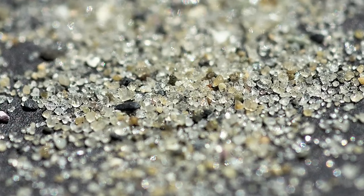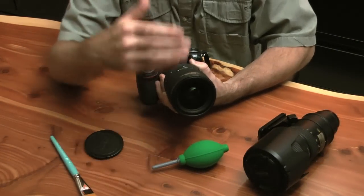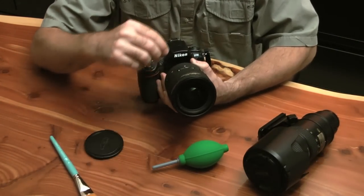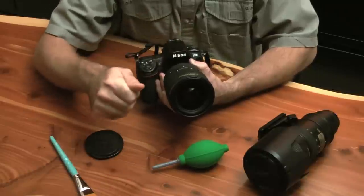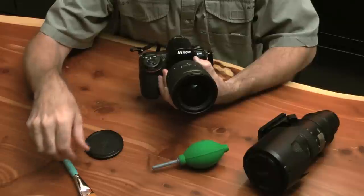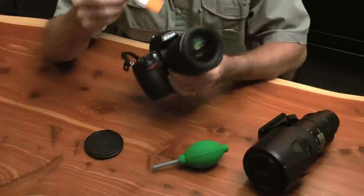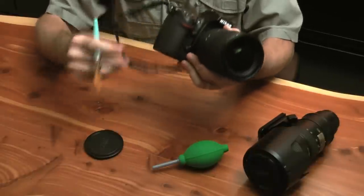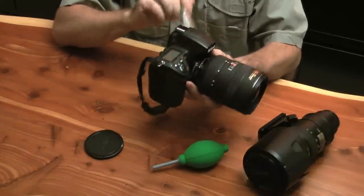It's rocks — actually very small rocks. And if we get to the point where we're using a cloth and smearing or wiping any of this debris, we're literally taking rocks and scraping them against our camera. So we want to make sure that before we start doing any kind of wiping or rubbing of the camera, we take plenty of time to make sure there's no large debris anywhere.